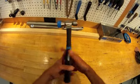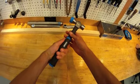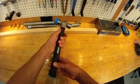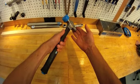The hammer is grasped firmly. We do not hold it 90 degrees to our arm. We tend to hold it in line with our arm. We want to hold the hammer up, choking up on the hammer when tapping for light precision taps.